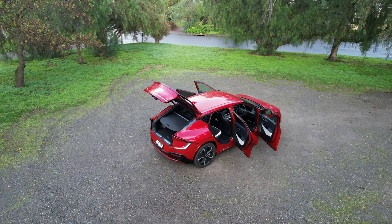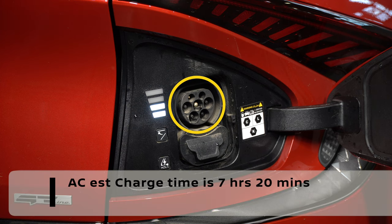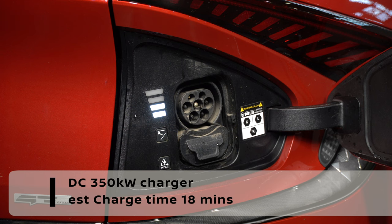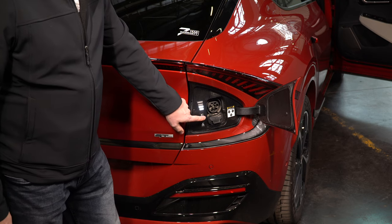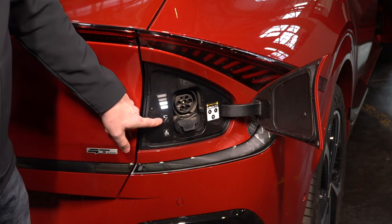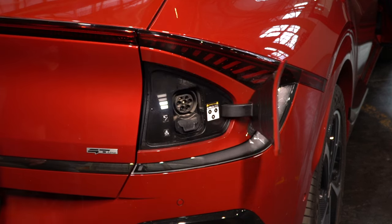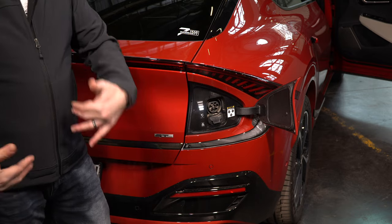The vehicle is fitted with a lithium-ion battery with 77.4 kilowatt hours. It charges through the driver's side rear tail light. It's got AC and DC charging points — on AC the estimated charge time is 7 hours and 20 minutes; on a 50kW DC fast charger it's 73 minutes; and on a 350kW DC charger you should be able to charge the whole car in 18 minutes. The charging flap can be tricky — you press a button to open and close it, and there's a small protrusion on the back of the flap that presses the button when it closes. If you forget to close it and start the car, it will automatically close the flap for you.